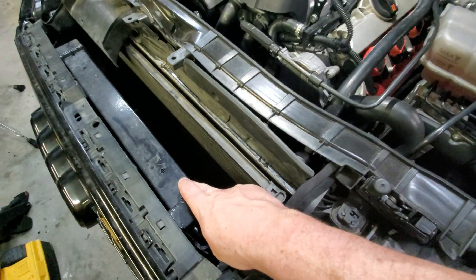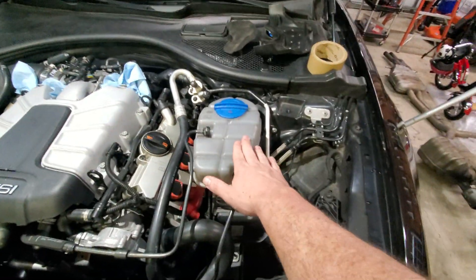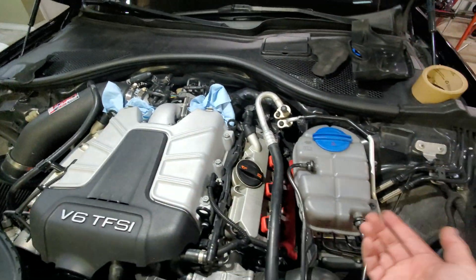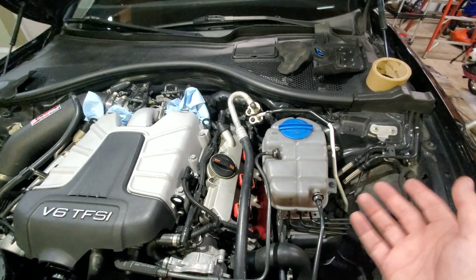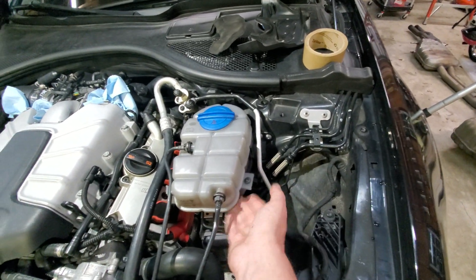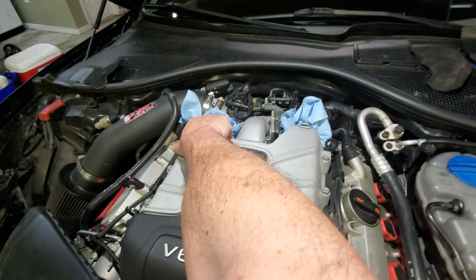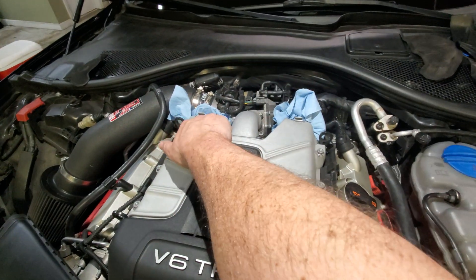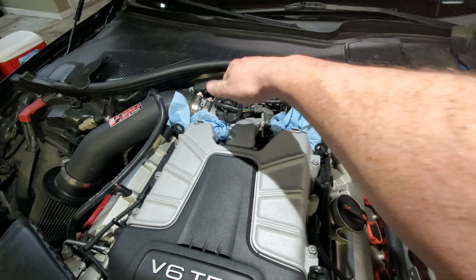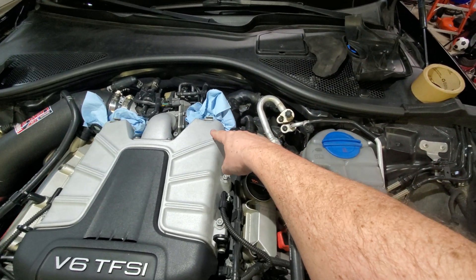After that, all you have to do is bleed the supercharger. If you can get the reservoir up above your bleed screws — which are right here and in here — you don't have to do anything fancy. Undo the screw, undo the clip, get something underneath to raise the coolant level above those bleed screws. Start with the lower one, which with the driver's side up is the lowest point. Back that screw out just enough until liquid starts to come out, then close it. Then do the one on the right — that's your highest point. Open it up, back it out until fluid starts to come out, you'll hear the air escape and then it'll start spraying coolant, then tighten it back up.